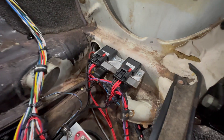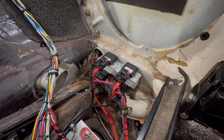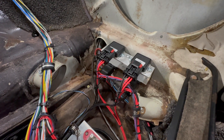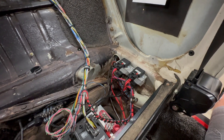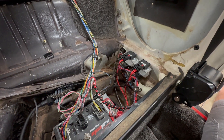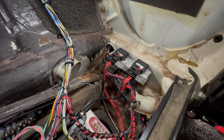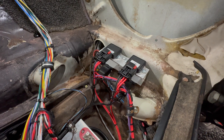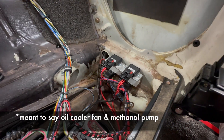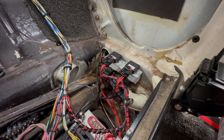Let's talk about component selection. These are standard ignition RY330K solid state relays. I chose these for a few reasons: a lot of the Bosch style mechanical relays you find now are basically import and I question the quality. I wanted something with decent quality. Also, being solid state, if I ever desire for things like the fuel pump or methanol pump, you can actually PWM these solid state relays to control the power output to the load.